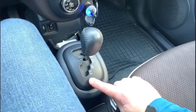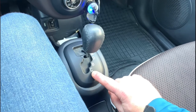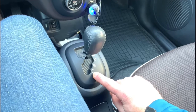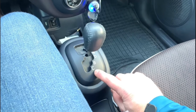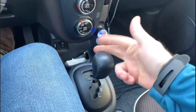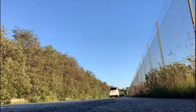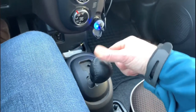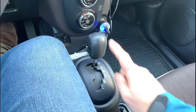C is for highway cruising. If you're on the highway doing 100 km/h and lift your foot, you don't want the car to brake hard, so you don't need as much energy to get back up to speed. C brakes less and gives you a smoother ride. If you don't want to think about it, just put it on D. If you're going down a very steep hill, like in a tunnel, put it in B — it will brake even more and recover more energy. You can't start the car if it's not in P.